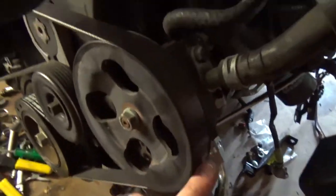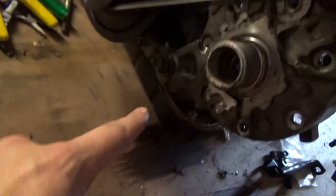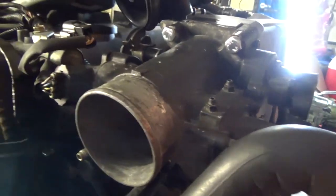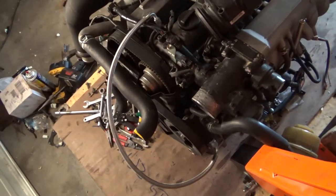Here's that line I was talking about, and you can get that Gates part number from my part one video for the AC delete belt — it's the right length. This is the belt routing in case you need it. Basically you take this off and it is gutted on the back — you take all that out and it's hollow inside. You take those two or three bolts — that supports the power steering pump — and then you won't have belt problems. I have never had a belt problem in three years of driving my car, and I clutch kick and spin out and do all this dumb stuff.